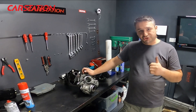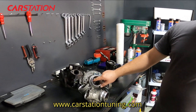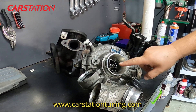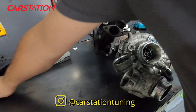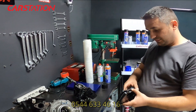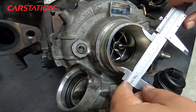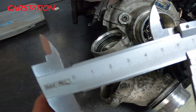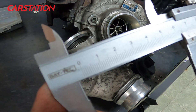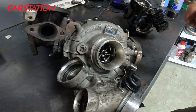Friends, we have now removed the turbos from the Alpina D3 and taken them out. Now I will show you the main turbo. As you can see, you can see its current diameter. So that you understand more clearly, I will now show you with a caliper. When I measure the inside, as you can see, it is approximately 67 millimeters — that is on the intake side only.